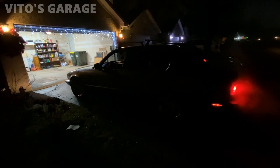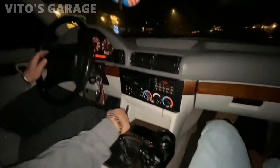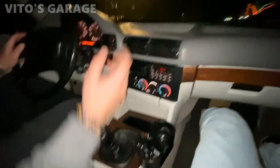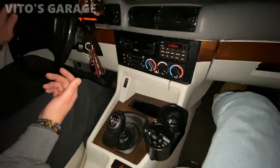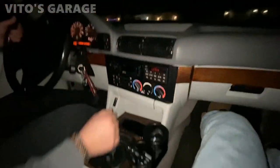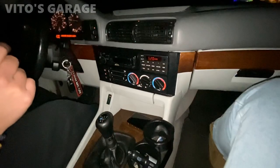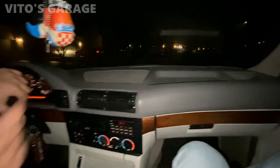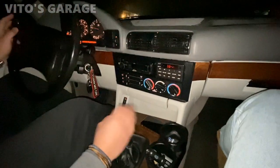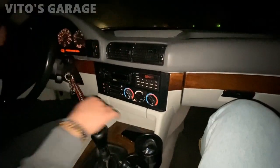Look at that E34 — so many memories with this car, they all just flash by when you're in the car again. Feel how close the gears are — like 3rd and 4th. Put it in 4th — see how close they are? Did you rebuild the shifter? I changed the main bushing and the ones on the selector rod on both ends, but I don't know what else I'm missing to get rid of this slop. We'll have to look at the schematic of the exploded view to see what bushings are involved.